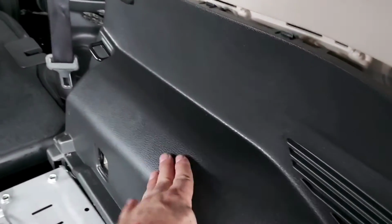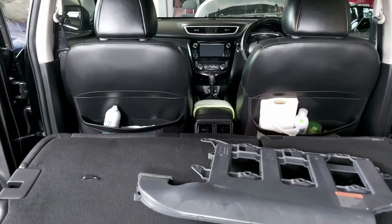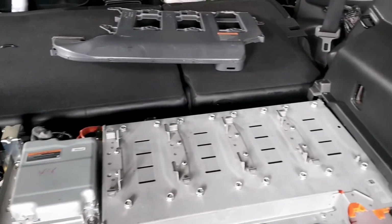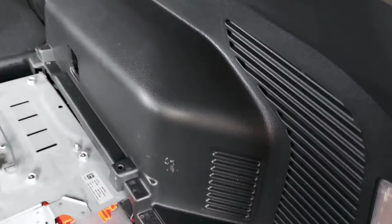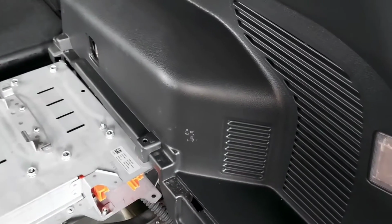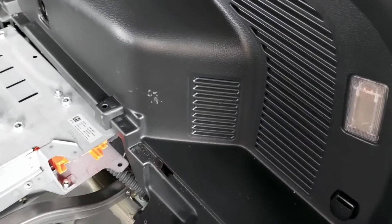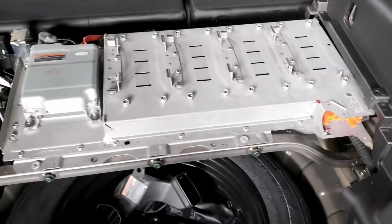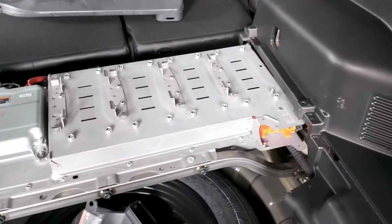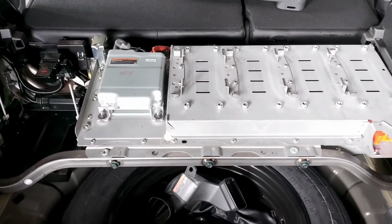It has been using for a long time the shiny silicone sticky products to make the vehicle shine, and well, those products are oily, and of course, as oily products, they come directly into the ventilation system and get stuck into the fan, and of course that brings trouble because the fan gets sticky, and if it gets sticky, it absorbs all the debris and dirt and starts clogging over time and losing a lot of efficiency when it comes to cooling. So we're just gonna take it apart, completely clean it, check all the components, and we'll continue then.